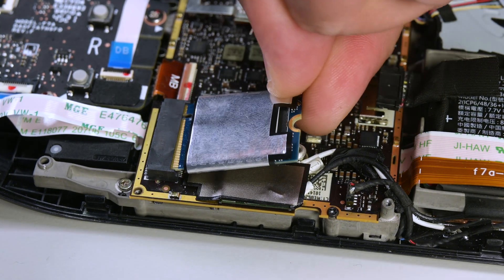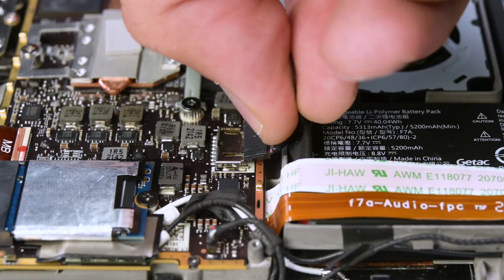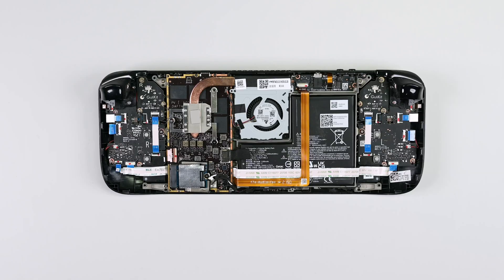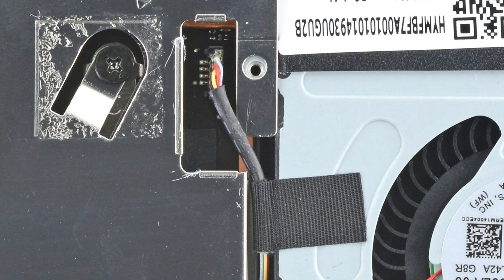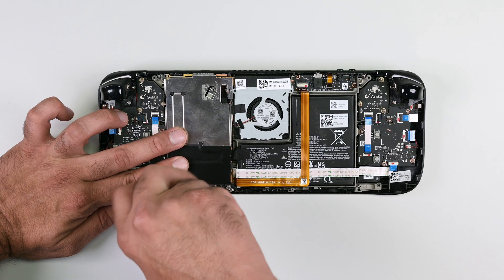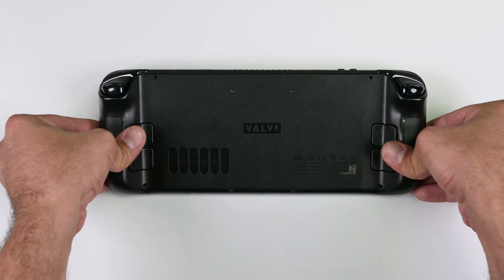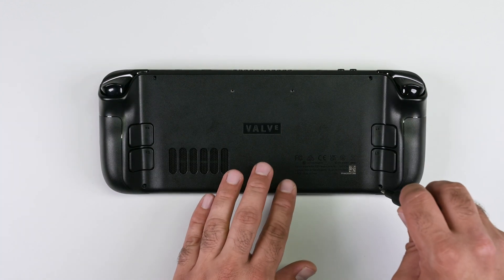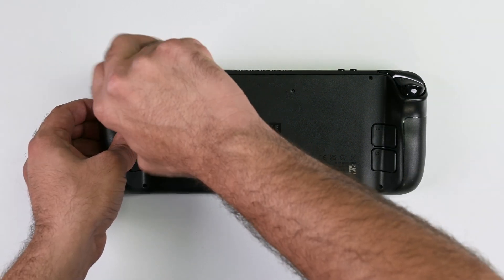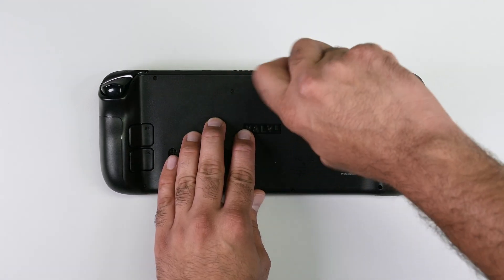Let's pop the SSD back into its M.2 board connector — it should fit nicely and snugly — then screw it back in place. Now reconnect the battery cable to the motherboard. For those with the black motherboard shield, skip this step; for the rest, bring that silver shield back into play. Gently lay the fan cable to the side, making sure it's free from any potential tangling, and secure the board shield with the three Phillips screws you removed earlier. Carefully align the long edges of the back cover with the device, press down gently to engage the locking clips, then tighten up the eight screws that hold the back cover in place. Remember, the innermost four screws are shorter than the outer screws.